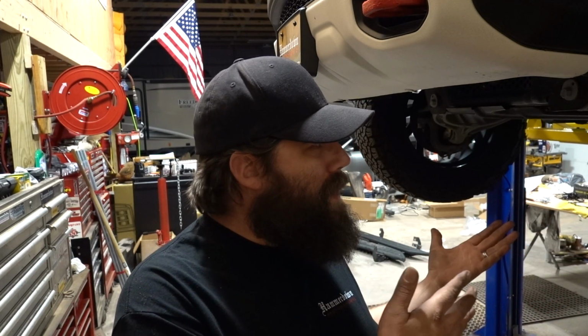All right, so with the wiring, it's not too terrible. Just take your time. Make sure you're routing it in a way that it's not going to pinch up against something or by anything that's going to turn or get hot or anything like that. Obviously, you have your exhaust on either side, so you want to stay on the other side of the heat shield.